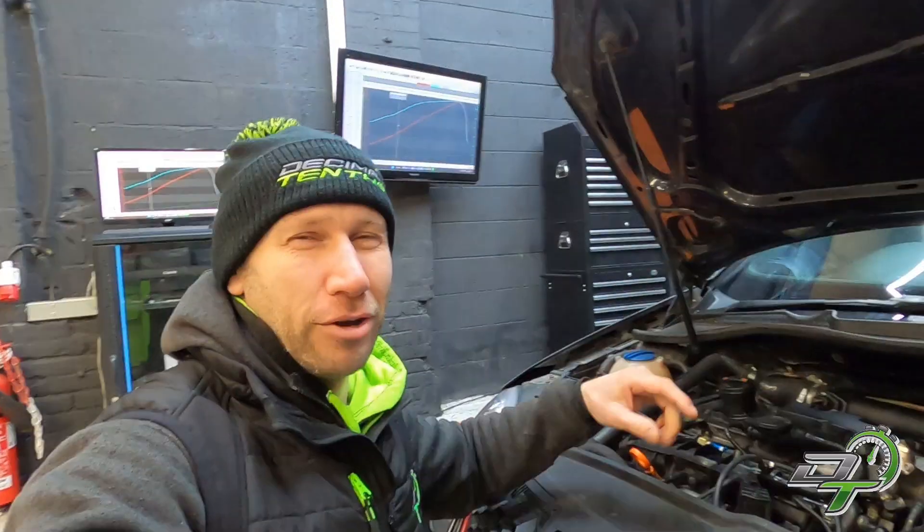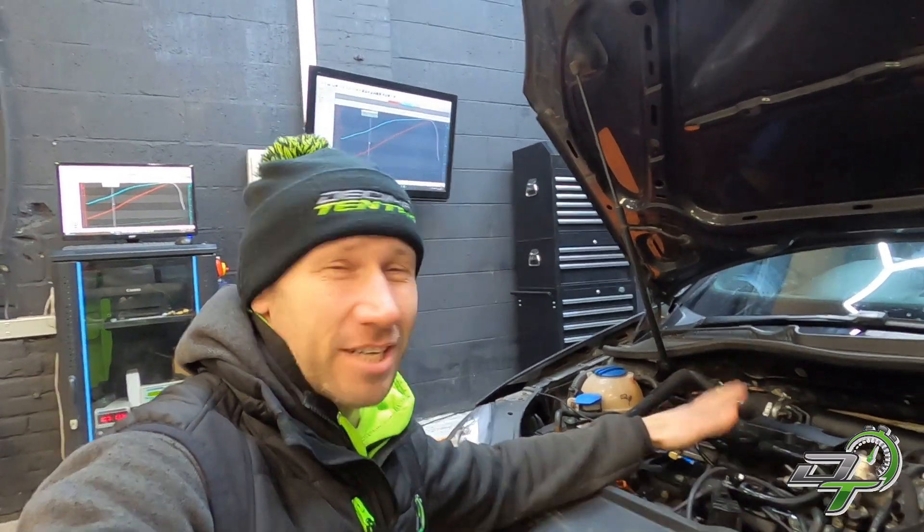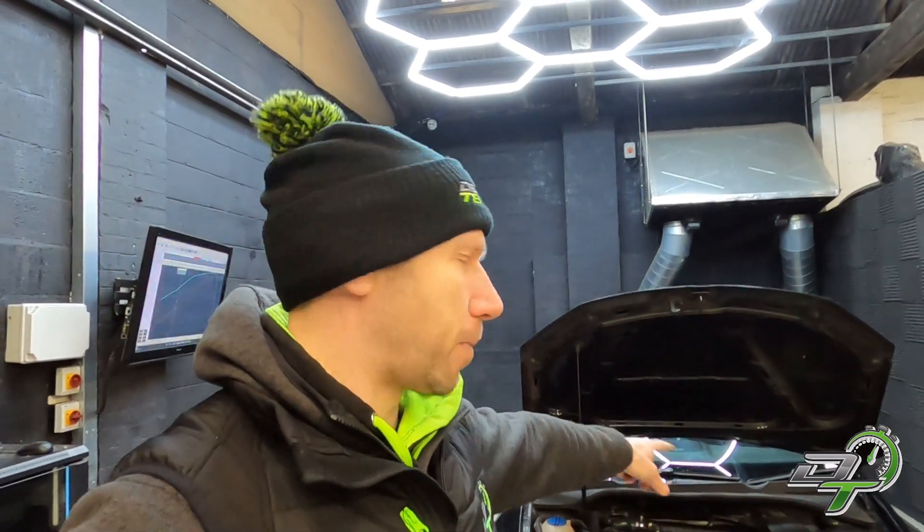There are actually a few little upgrades on this car. Can you guess what it is yet? The relocated diverter valve is probably the big giveaway — this car has now got a KO4 turbo. I took a punt on the KO3 and was quite happy with it to start with. But a characteristic of the KO3 is that because the diverter valve is mounted on the compressor housing, you tend to hear it opening a little bit when you have a hard pipe induction kit like the Forge one. On a solid pipe it tends to reverberate, and in all honesty I don't like it. I drove it for a bit even on wastegate pressure and wasn't happy with the diverter squeal — it was just the way that turbo had been machined. So I decided to go to a KO4 setup.